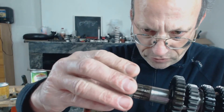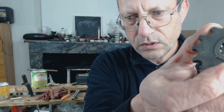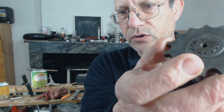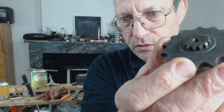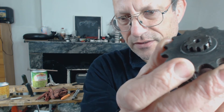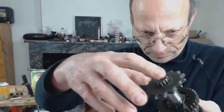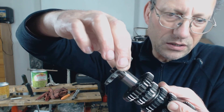If we put this on here, you can see there's a bit of play. This is an old pinion — not new — but it's quite tight at the top. As we go down to the middle section, look at the play. Every time you accelerate, it can bang into the metal, and the more deformed it is, the more deformed it will get. It's no good.